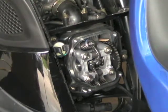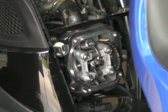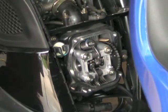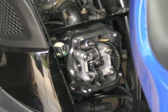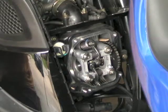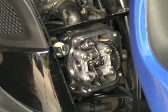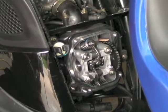We'll put everything back together. One thing I am going to do — the service manual says to turn over the engine a couple times and make sure everything is kosher. Got it done. I've got to get it on top dead center. My T is lined up. Double check — my big hole is there and my two smaller holes are vertical, which is good. Then I'll come back and measure again just to make sure everything is still kosher after turning it over.